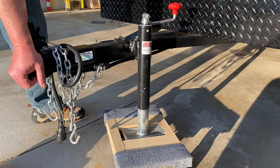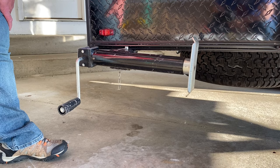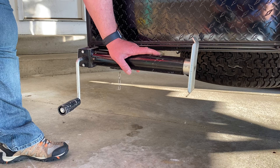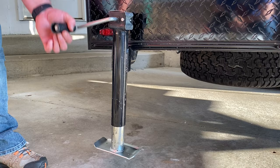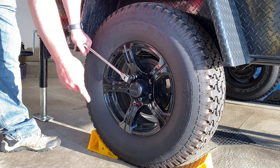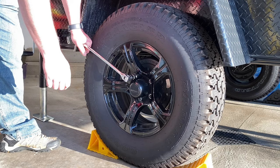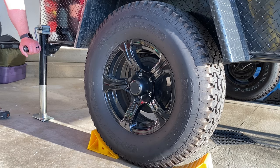To make it very stable in the front when taking the wheel off, we're going to bring out the wheel dolly. On my mid-range I have jacks — these are 2,000 pound rated. I'm going to deploy my rear jack. These jacks will lift the tire off the ground. We're going to break the lugs loose before we raise the tire off the ground — once we do that we can just spin the lugs off. Now that we've got the lugs broke, we raise the back and front evenly and take the tire off the ground.